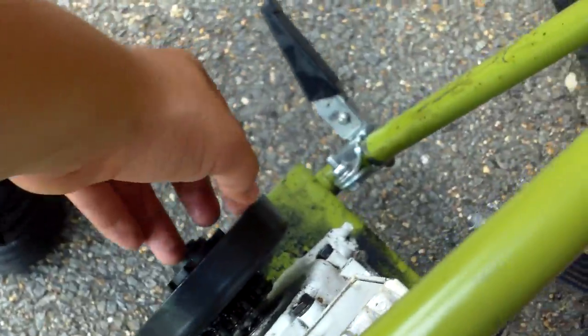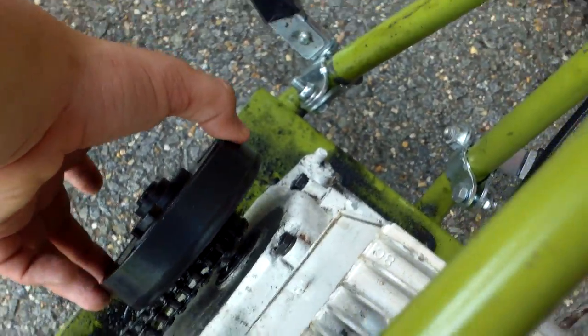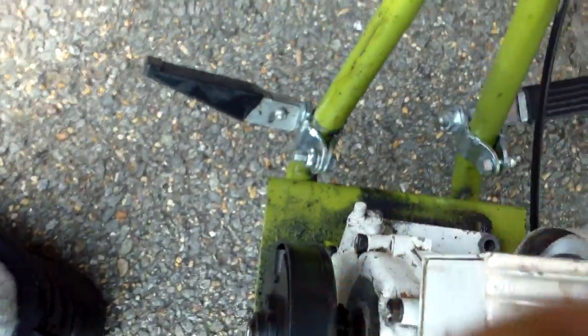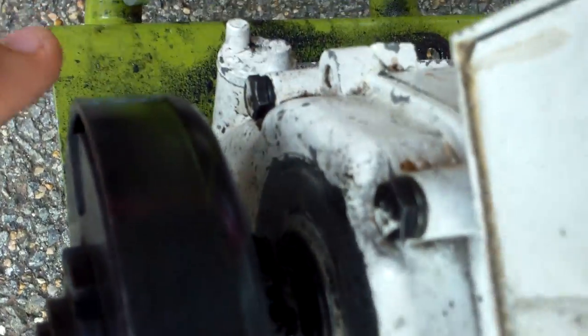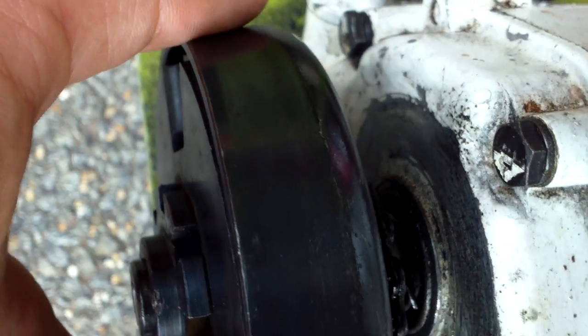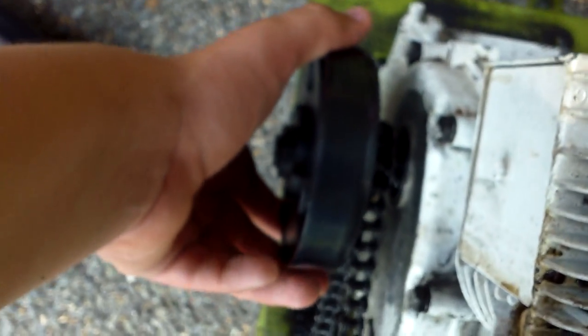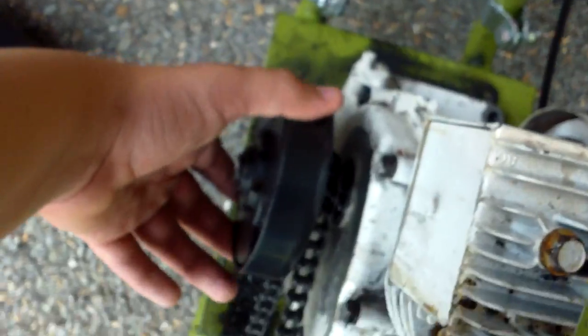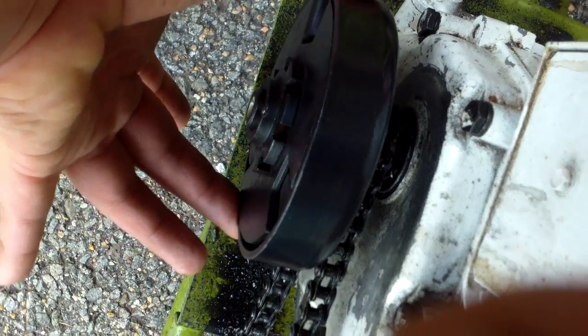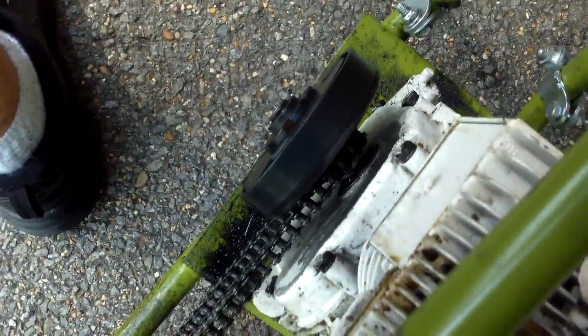I have a bad centrifugal clutch because this clutch is possibly over 48 years old. So the first sign you want to check is when you see the clutch — it's not supposed to wiggle to the side like this. When it wiggles to the side, that's because of strain, so one of the bearings are bad in there, or it's shaving metal or something. That's sign number one.